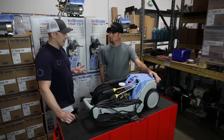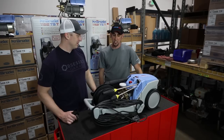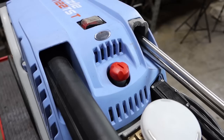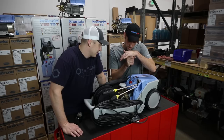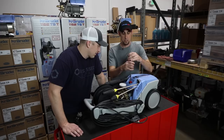I noticed I had an issue getting the oil cap off — have you cheated here? I did cheat. The Germans designed it so the slot in the top of the oil cap is just the size of a euro coin, which is supposed to help. But you still need an iron grip. I use a heavy-duty flat-tip screwdriver and apply enough pressure as you break it loose. From the factory, you find it's tighter and harder to get loose than after you've removed it a handful of times.